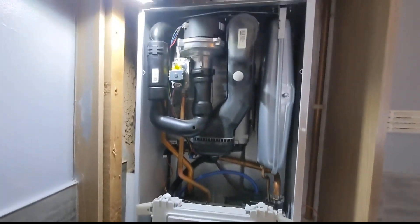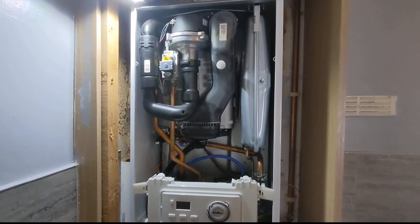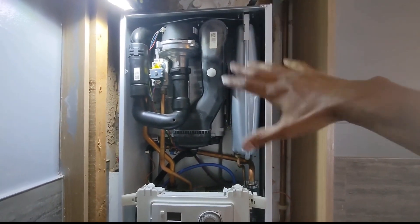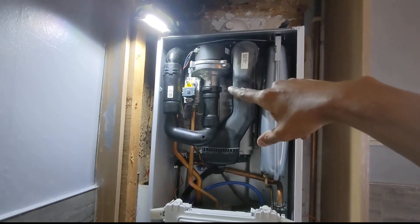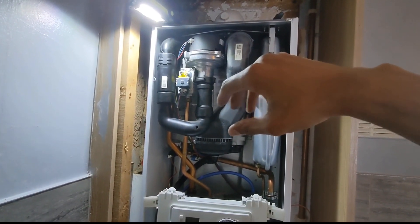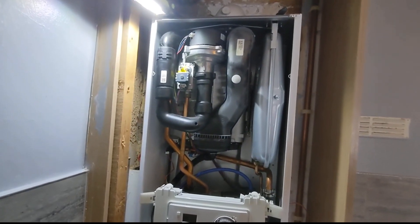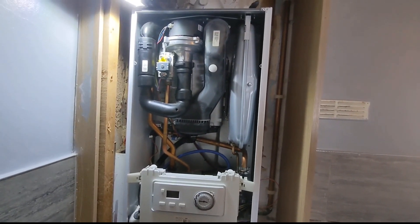That's all back together now. I'm just going to carry out my 26.9 checks on the boiler to make sure everything's good, and we should be good to go. This goes to show how easy it is to actually change the sump on that - it's not too bad. Clean out the main heat exchanger, just take the burner out, flush it through with water, and then put it all back together. Obviously change the seals when you take the burner out. Hope you guys found this video helpful - any comments or questions, leave a comment below. Cheers guys.